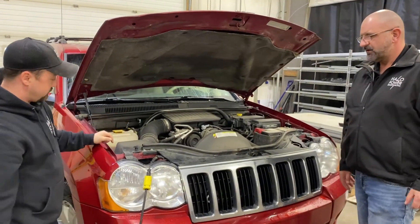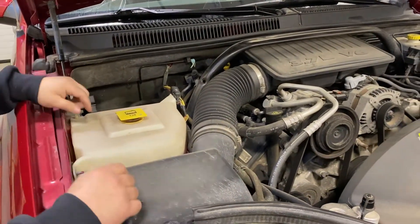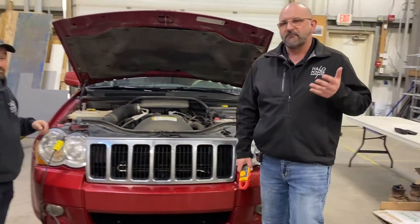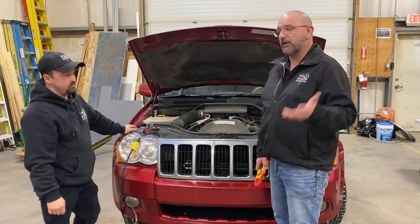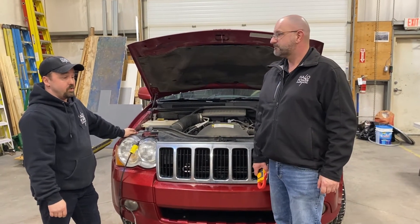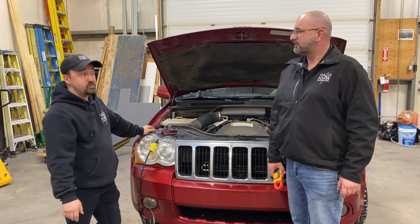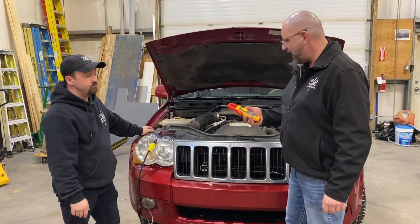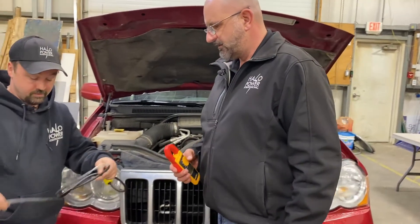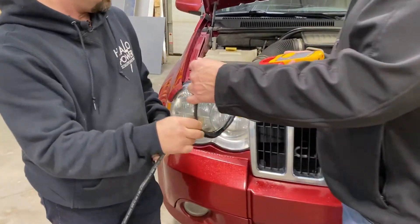So we've plugged it in. A lot of people don't realize how much power a block heater actually draws — they just plug it into their outlet and it works. But if you've got three vehicles plugged in on the same circuit, you're taking the combined draw from every one of those vehicles and that's going to potentially overload the circuit. We've got an amp meter here and — don't try this at home, kids, we are professionals — we're going to take an amp reading on the block and show that it is working.